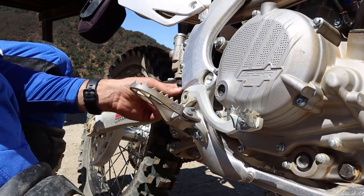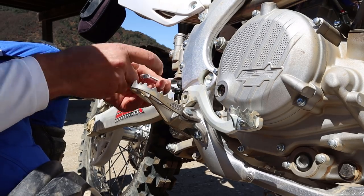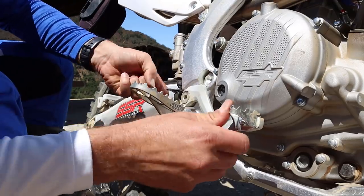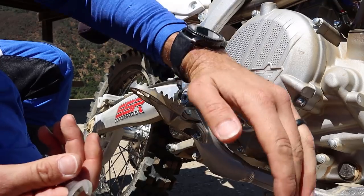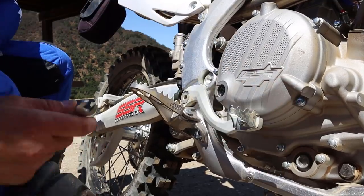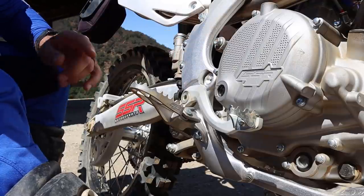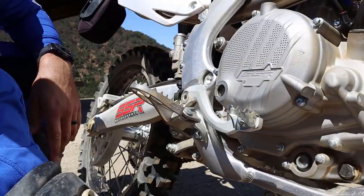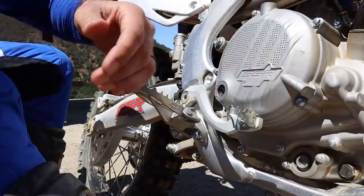Yep. And then this jam nut was loose, but not anymore, because we got one of those fancy 10mm. So that is quite a bit higher. It's like right there, actuation and engagement, which I like. So we fixed that. Now we got to flip the bike around and probably do a quick rejet since we have jets, and we know that carburetor is really holding up the show right now, so let's get to it.